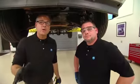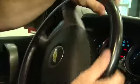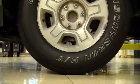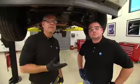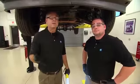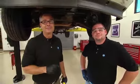You can use a dry park test. You can put the truck on the ground and turn the steering wheel to the left or right, and you're looking for any binding. You can see binding either in the parallelogram steering system or the steering gearbox. You'll have to address that issue. You also need to run a power steering flow test. Make sure you've got fluid pressure to it so you can turn that wheel to the left or to the right.